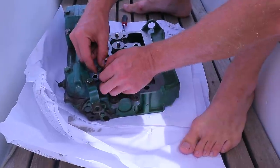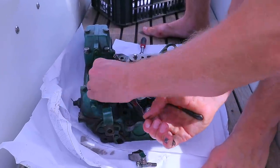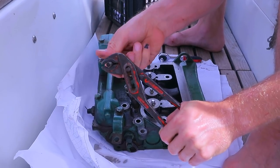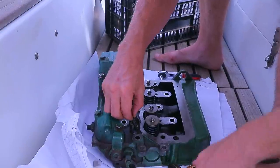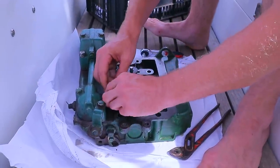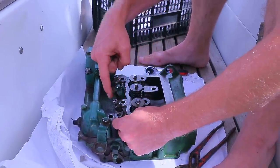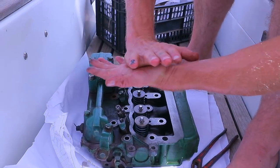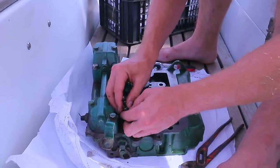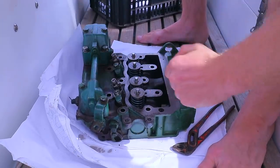The stud is screwing out instead of the nut coming off, but it's okay - I can deal with that. As I screw down the nut and washer onto the yoke, the yoke has a pivot point and basically as we squeeze it down the yoke pushes the injector down and seats it. It's the pressure of that against the copper sleeve which prevents the combustion gases from escaping.